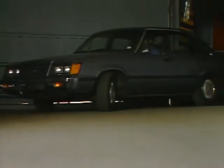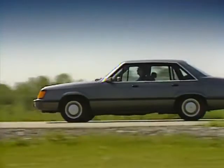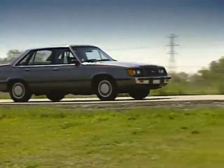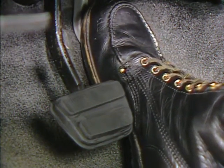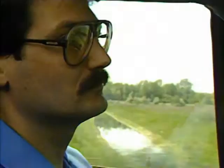Before beginning any rear axle adjustment or repair procedures, you should road test the vehicle yourself. Sounds and vibrations originating at the rear of a vehicle can come from several sources, and the rear axle or differential gear set is only one of them. Not properly diagnosing a problem can result in a great deal of unnecessary work and expense, and a service return by an unhappy customer. When making your road test, slowly accelerate the vehicle until the maximum noise or vibration level is reached. Then play the accelerator back and forth slowly, backing off and applying it lightly. If this causes the pitch of the sound to change, the problem is either the transmission or the rear axle. If the pitch doesn't change, the problem is somewhere else.